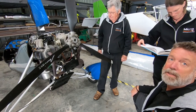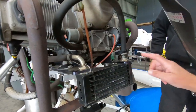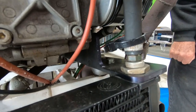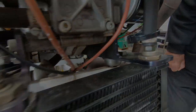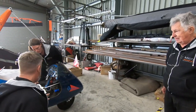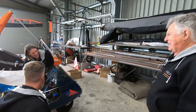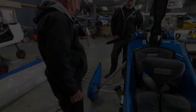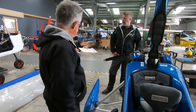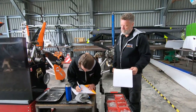The engine mounts have been mounted wrong. You see those are sat on top, but these ones, when they've been replaced, are underneath, so the plates are twisting — it's just gone solid. There's a hell of a lot of wobbling. There's a lot of TLC needed on this one. This is going to be one where we just write down lots of things and then go: that's what's wrong with it, this is what you thought it needed, and this is what it really needs.